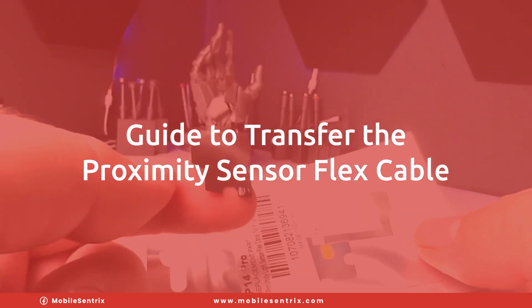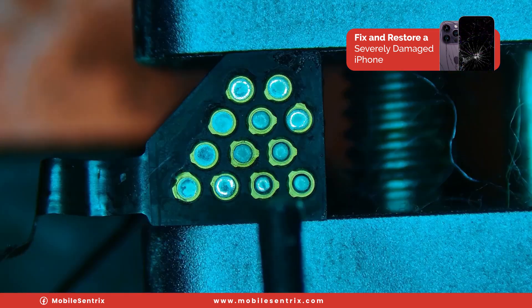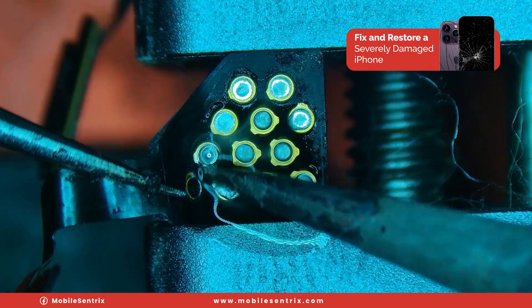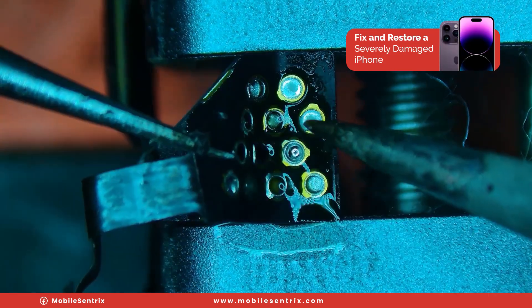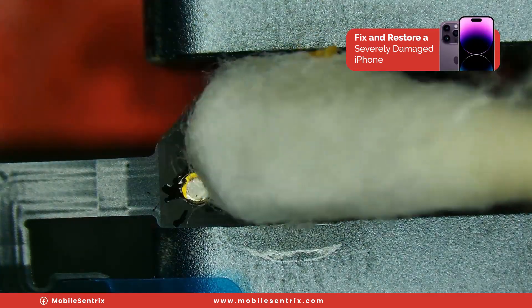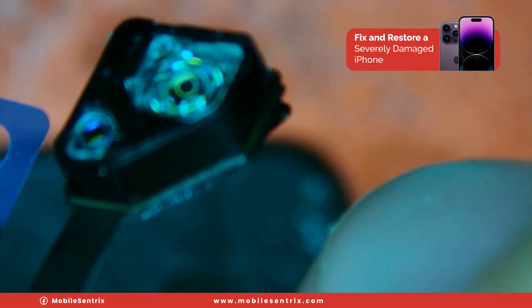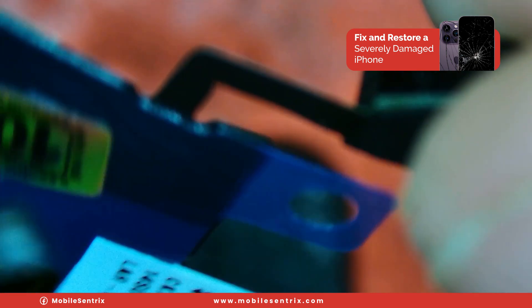Let's take what we need off of here and put it on here. We need to carefully remove this sticker, trying to get it with all of the adhesive, and set it aside. We've got it clamped up. Add a little bit of flux. We'll grab the flex cable and carefully melt the joints one at a time, letting the solder basically sink through, letting the flex cable let go of these joints as it does. Now we'll take our brand new flex cable, line it up, and gently touch each one of the holes, letting the solder come up and through. Take a Q-tip with a little isopropyl alcohol. Take the sticker and put it back on. Just like that, we've installed that component on the new flex — it does not have a tear in it, and it already has the sensor installed. So that's all we need to transfer over.